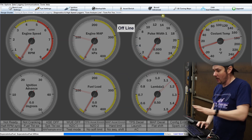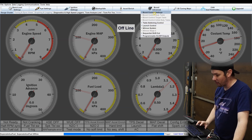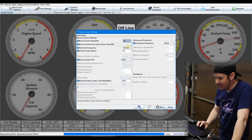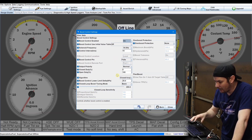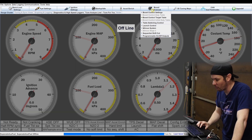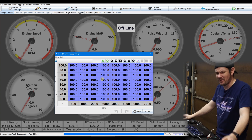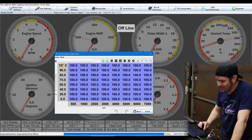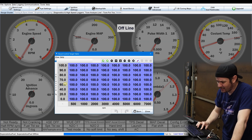We've disabled 90% of the things we can do on this. We will touch on boost control eventually in a future video. I'm a little perplexed that we can't dial this in off of a pressure table. Maybe I just need to do more reading, because the target table looks to be a duty cycle table based off throttle position, which is something else that's weird. If you know of a way to change these tables to different inputs — like manifold pressure versus RPM instead of throttle — that would make a lot more sense to me.